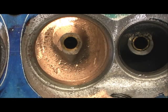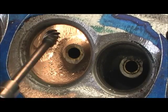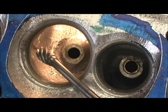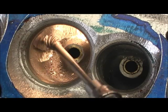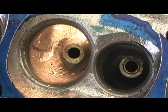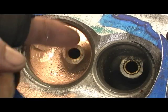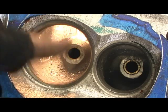So let's go in there and see if we can modify that turkey bird a little bit, get it a little bit more aerodynamic. Things I want to point out — look at the line. Look how when I was grinding the pole, I did not take meat out in this area. You're playing with fire right there. That's the reason I stayed off center to it — that's where the bolt hole tube is going to go. And I will not go but about right here shaping this.